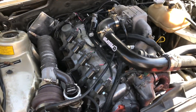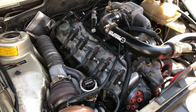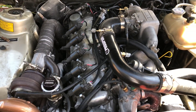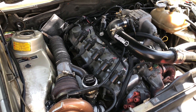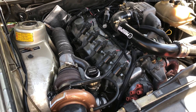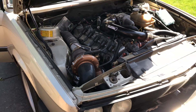I've been running it on E85 but just switched back to 91 octane. When beating on it I get about 17 mpg on pump 91, and on E85 it's like 13 mpg. The E85 is the same price as regular gas in our area but it's really not worth it at this boost level, even though it makes the car run so much better and feels more responsive. On 91 octane, leaned out to about 15.5 AFR cruising at 75 mph, I can get 27 miles per gallon — did a 100-mile round trip and confirmed that.